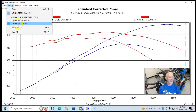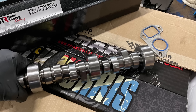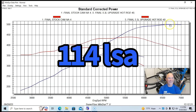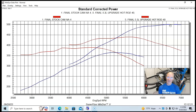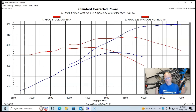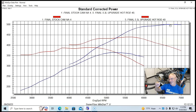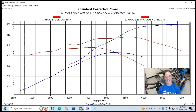We also wanted to find out if we could do this with an even smaller camshaft, and the answer is yes. After putting the Red Hot cam in, I put in the smaller Hot Rod cam - around a 217 cam - and that one just made 500 horsepower: 500.7 or 500.8. It just squeaked past 500 horsepower by the skin of its teeth, but it did make 500 horsepower even with that small cam. So 500 horsepower from a 5.3 liter - this is what happens when you get close to a number. Make sure to like, share, subscribe, ring the bell, and I'll keep testing.